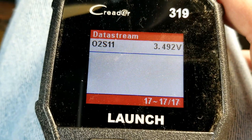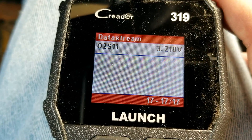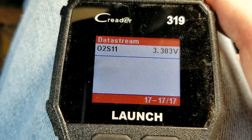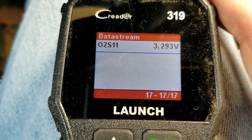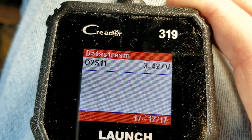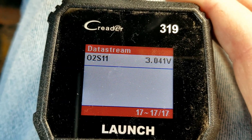I'm going to push down on this brake and then let up on it. You can see it went up to 3.5 — now it should drop down to about 3, now it should go back to where it was at. And yeah, that's doing what it's supposed to be doing because we caused it to go into a slight lean condition, since these are vacuum-assisted brakes. I'm going to do it one more time.